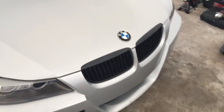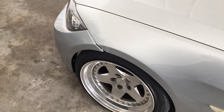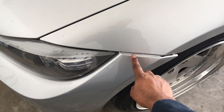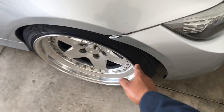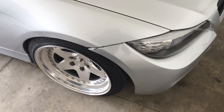Okay, so I'm starting to go ahead and take this bumper off. The first thing I'm going to have to do is get the front part of the car in the air so I can take the wheels off to get access to the two screw bolts. There should be one here and one here on the bumper tabs on the sides, and another one over here, here, and here.